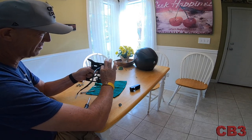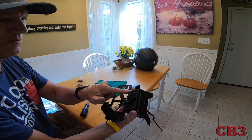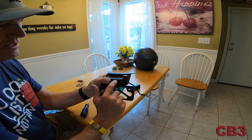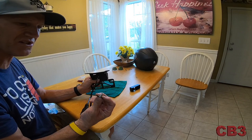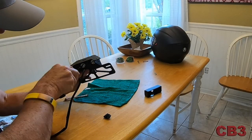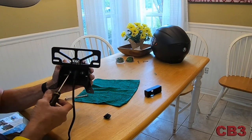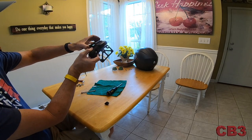As things start to bind you can reach in through the back and pull these pieces through. Everything looks good, nice and flush. Now notice there is a channel right there — that little channel is for water, so make sure that channel is on the bottom. Press it in. You might have to work it around because this light has never been in here before. Now use these shorter screws because that block no longer exists. Remember, you are going into plastic — you do not want to overtighten it because you will strip it and break your light.